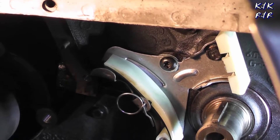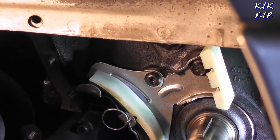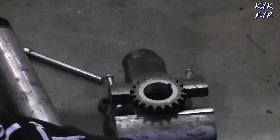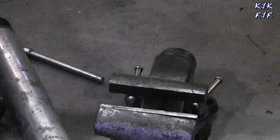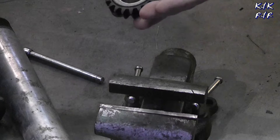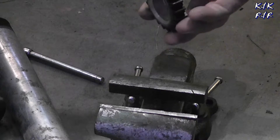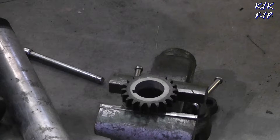Don't pull that pin until you've got your chain on — call this the grenade pin style tiny chain. One thing I've found over time doing these jobs is that heating this gear up is the easiest way to put it on. It doesn't require banging or a lot of torture on the motor. There is a front and a back side — put the back in first. You won't have your timing mark but the back edge is beveled so it sits where it should ride for the chain. Make sure you have gloves when you do this.